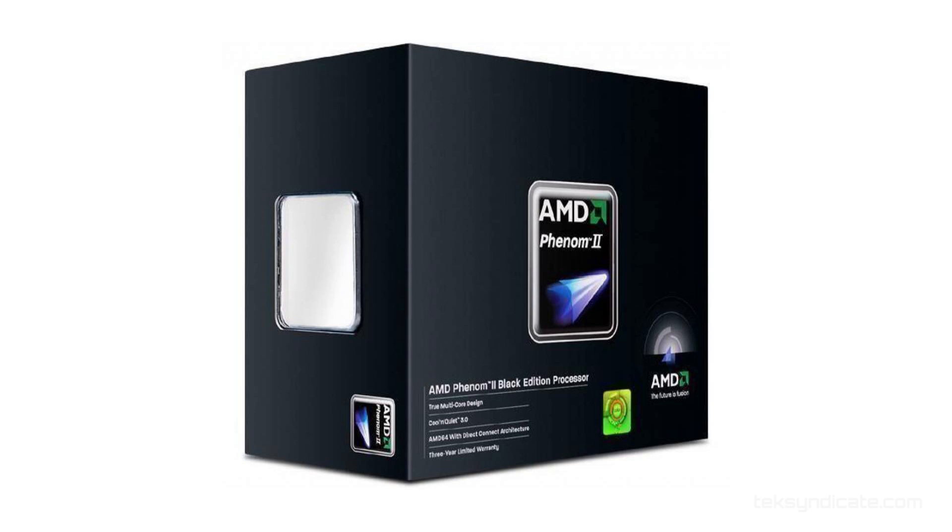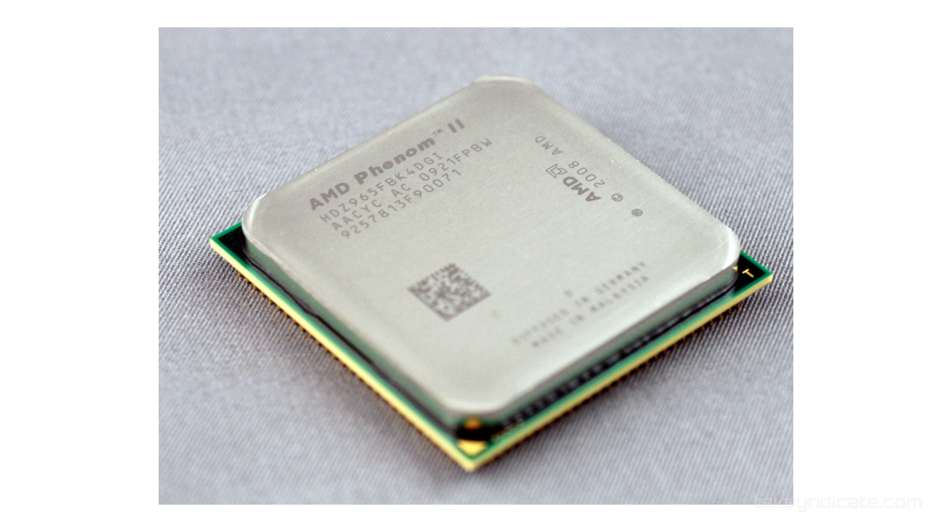Alright, so let's start off with the $600 machine. AMD Phenom II X4 965 Black Edition — it's a 3.4 gigahertz quad core and you can overclock the hell out of this thing because it's the Black Edition, it's unlocked. It's $99, and get this: the more expensive 1055T, the 6-core — this thing beats it nine times out of ten in just about everything.